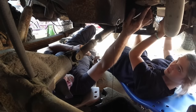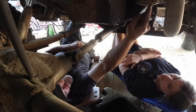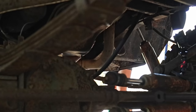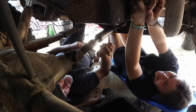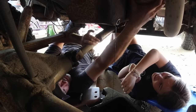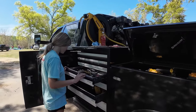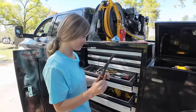Okay, this is your oil filter right here. Now we're going to take this off, and we're going to go this way with it, right? Counterclockwise, lefty loosey. All right, so see if you can get it with your hand first. If not, we'll get the tool, because when we put this thing on, we're not going to tighten it down. Okay, that's okay. I don't think you can do that. Black handle, this black handle with big curved jaws on it. That's it. Yep, that's a filter wrench.